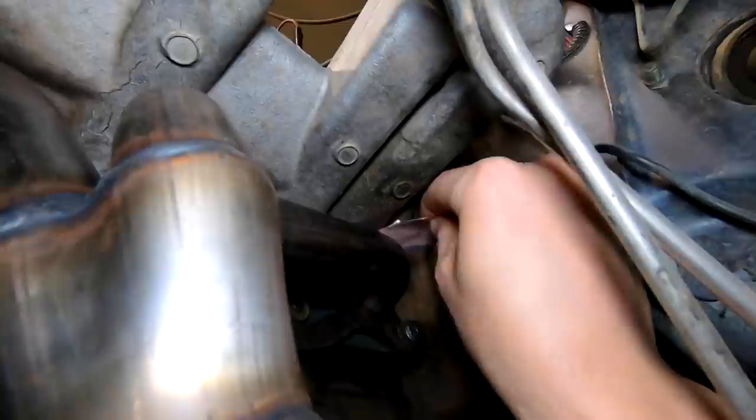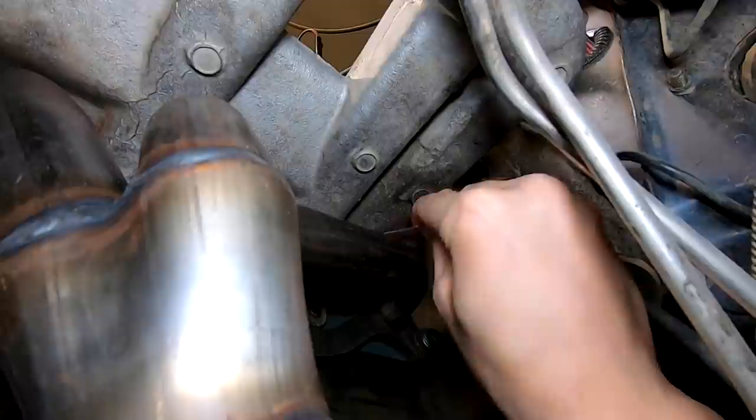And my final trick, just to make sure I know nothing is rubbing, because you also don't want it to be touching because it will transfer a little bit more heat into the intake manifold: I take a small sticky note piece of paper, something folded in half, and that's maybe like 0.001 inch. You just try to see if you can slide the paper in and out between the interference area. Now I've got it where I've got at least the thickness of 2 pieces of paper, or 1 piece folded in half.